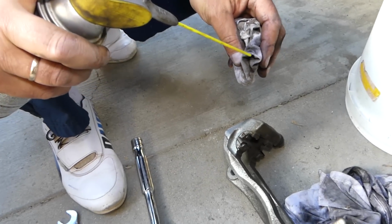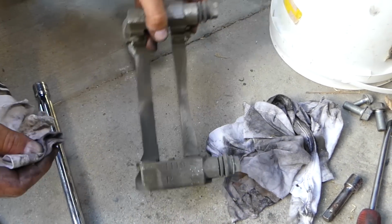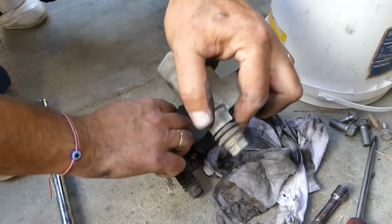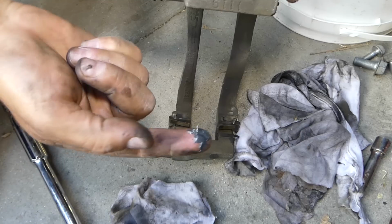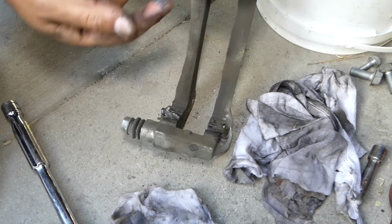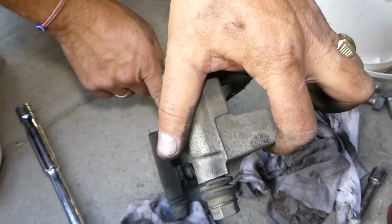With the rust penetrating spray, we're going to clean the glides. I would recommend even getting a brake kit with new glides. They're replaceable, but ours are pretty good. We don't have any rust here, so when you clean them, those things are like brand new. So we will apply just a little bit of brake grease now. You can find it in the description of the video below. On the glides now.